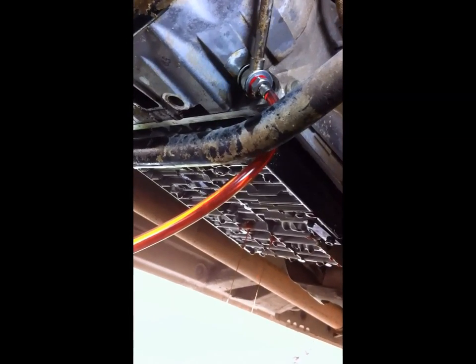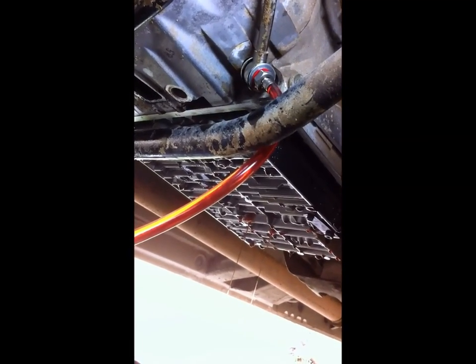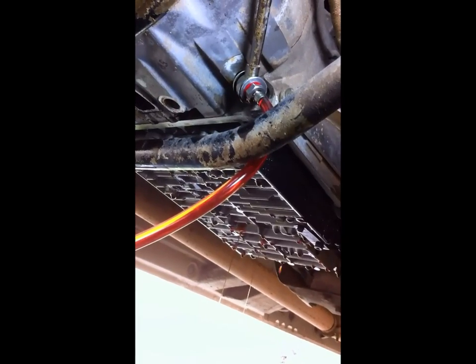So you just use the bottle with a compressed air hose set on about 5 psi. Let's pump it through. It's flushing out some of the galleries too. Great. Scott, yeah? When he pulls this off, you have to be ready to pass him the band.